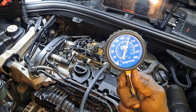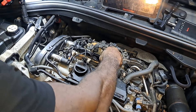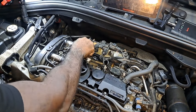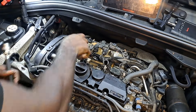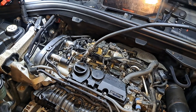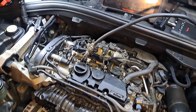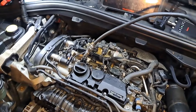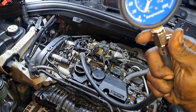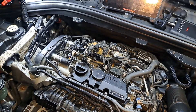That's a running compression of 180. Let me put it back in the other one and see if I can get it to build up like cylinder two did. It was slow to rise but eventually got to 180. I honestly think we're just dealing with valve problems.